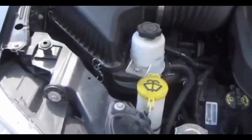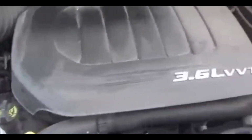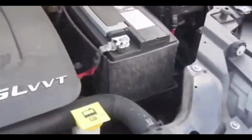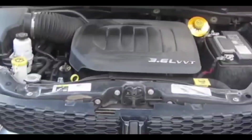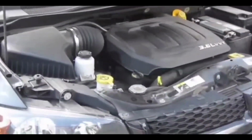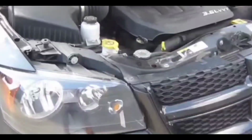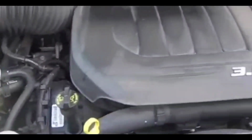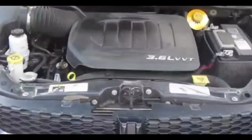If they don't turn easily, or if they don't turn at all, then you have one of those issues where the components are seized, and either it makes the starter not turn as fast, or it's going to keep the starter from turning. But anyway, I just remembered situations where that has happened in various cars.